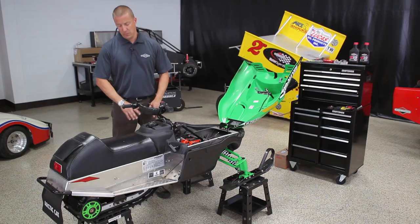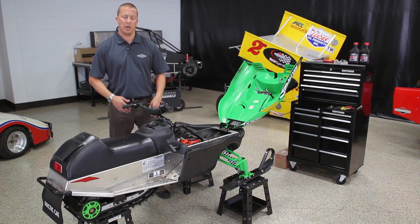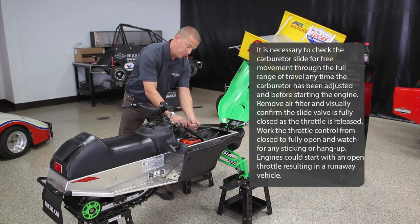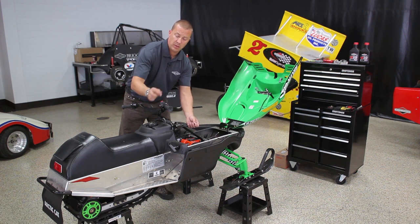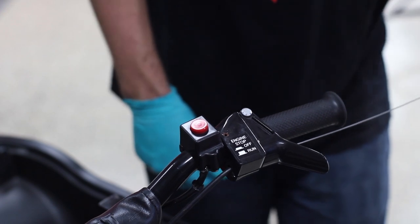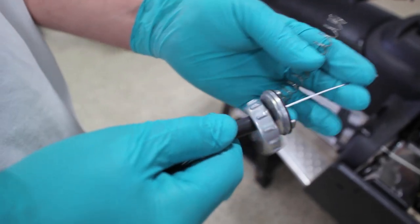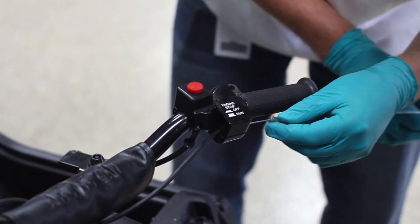Now we have the driver, the clutch, and the chain in place. We've put the secondary cover and chain guard back on. The next step is the throttle cable, which will take a slight modification. First, take a pair of snips and cut right below the housing, then make a secondary cut to take the ball off. That allows us to pull the cable out from the throttle side, and then we work backwards. We have a new cable that feeds back from the throttle down to the carburetor side. We'll hook it up to the slide in the carburetor, button everything back up, and then put a barrel stop on the throttle side.